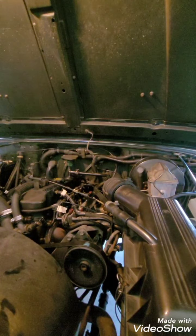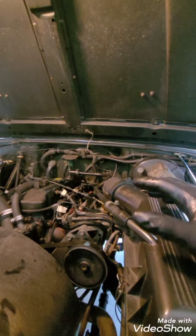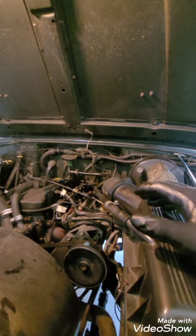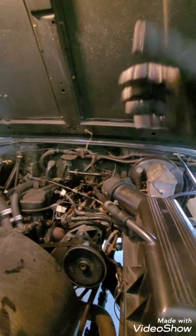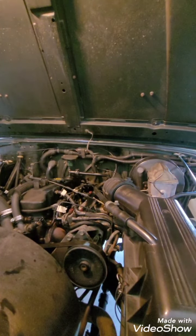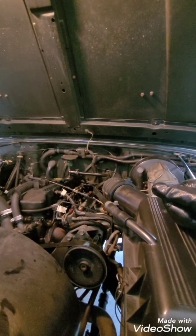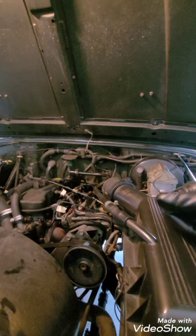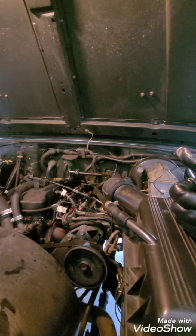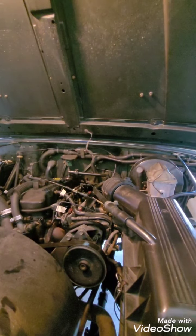I'm not a mechanic, I basically just play with my Jeep. I got to thinking maybe the resistance had built up because these originals have gotten so old, building up to 18, and that's why the fourth one burned out and was running 2.3. Now, I could be wrong; somebody that knows that stuff would know better. But I'm going to order some new ones, and hopefully the ohms will be more like 14.5. Maybe that'll fix some other issues too. I've always thought it was running a little rich. But anyway, long story short, that's what I'm doing.